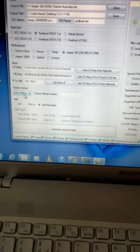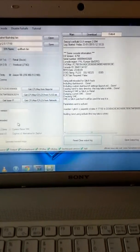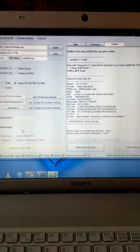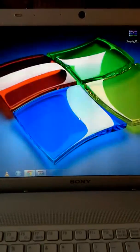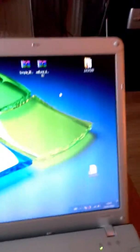This should automatically default to 2.0 / 17150. If not, you just click on the arrow and pick whatever. Everything's ticked. Generate hacked image — generate the hacked image. I closed the program. When we go in here there should be 2 files. It's your 2.0 — there it is. UPD flash. This is just a log file, just a text file — doesn't really mean anything.